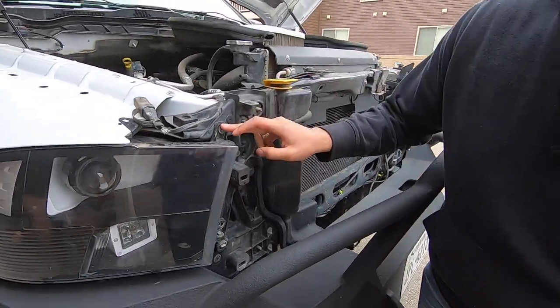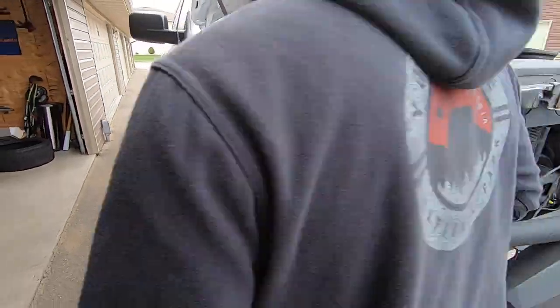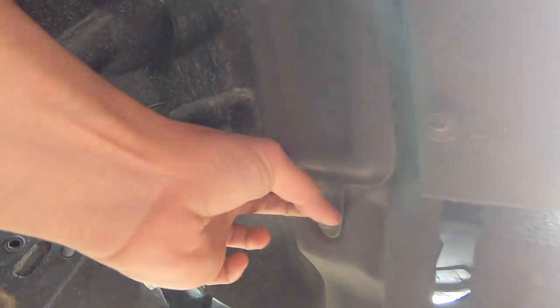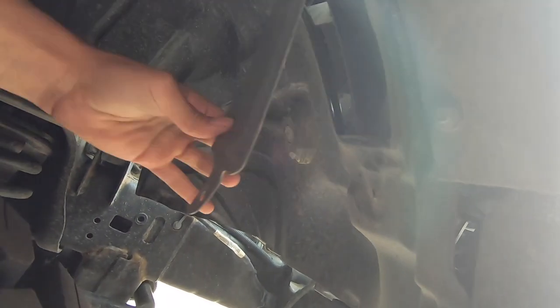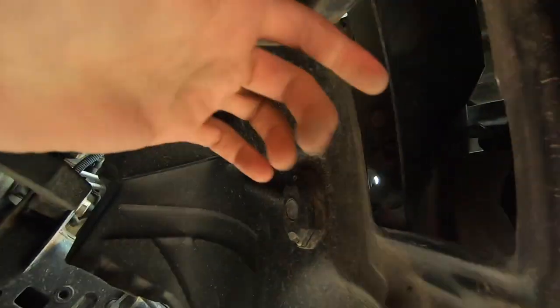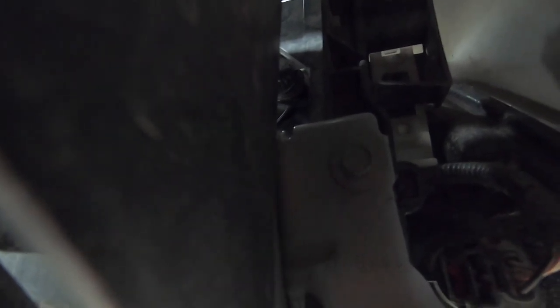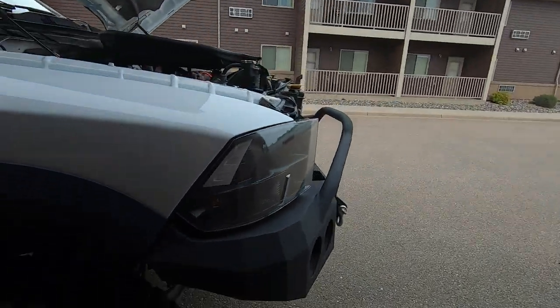So for the headlights: one bolt, two bolt, and then this little tab — I don't know if you ever wondered what that was, but it's for your headlights. Take it off — these clips do fall out so keep count of them. There's a gray tab all the way back there, like a white-gray tab with a hole in it. You've got to push it up, which I'll show you more when I take it off.